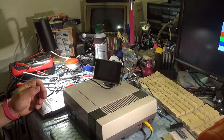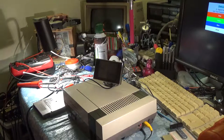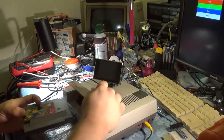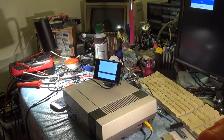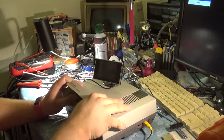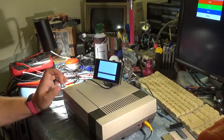We have the Nintendo on the bench and we're going to use the tiny screen to test it out, hooked up with the AV cable. We're going to pop Battletoads in and see what happens. We've got a white screen, which means we probably need to get in there and clean those pins out. We are getting a video output, which is good, and we are getting interaction with the cartridge. When it doesn't interact, the screen will blink on and off like nothing is inserted at all.